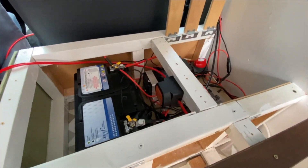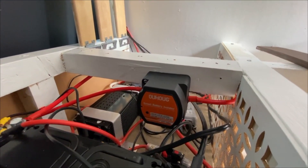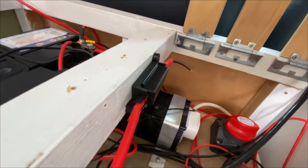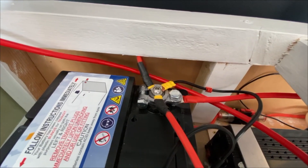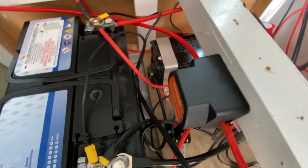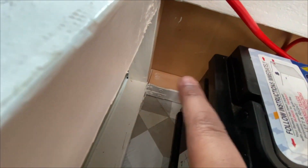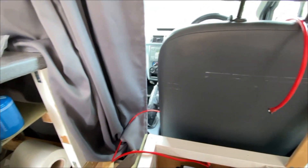It's the next day — beautiful weather. I've eventually put in the smart battery isolator just over here. I've got a wire coming out going to the back, into a fuse, out of the fuse, under this panel, and into the positive of the battery. Then I've got the negative coming out going to an earthing point — the wire is a bit short. The other positive from the isolator comes out and I'm going to feed it somewhere down there and eventually all the way to the van battery.